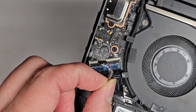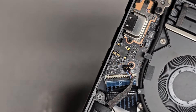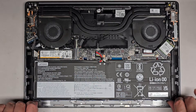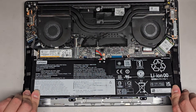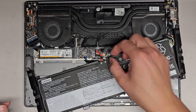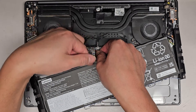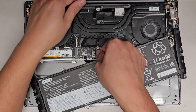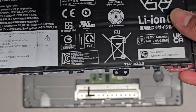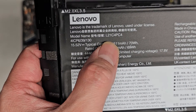Just like that — there's the speaker connection, it just pops back down. You can use a little tool to get underneath and pop it up. Let's go ahead and take the whole battery and speaker setup out — lift from the bottom, grab everything together. The battery is still connected, so we need to swing this over. Grab as close as you can to the connector and wiggle it side to side, and pull. We got the battery out. Here's the battery model number: L21C4PC4. If you order a battery, just make sure it looks the same.